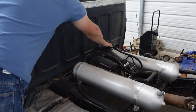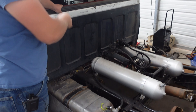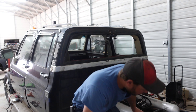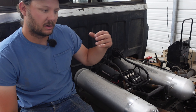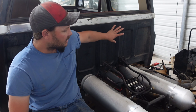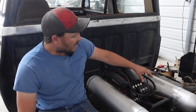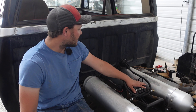Up here we did get most everything from Air Slamit, and from Phoenix because they're in Phoenix, that's why I went with them. We have their five gallon tanks - two five gallon tanks and two of their compressors. I don't remember what these compressors are. And then we have an Evolve manifold. All that's bolted down - none of it's tight, you can move it, but it's there. We're using Level Ride air management system. Right here on the manifold it picks up all our pressures from each bag. Currently these are correct but the controls on my phone aren't correct - the front is the back, and one of the bags when you air it up, it airs down. I don't know if the Evolve chart was bad or the Level Ride wire diagram was bad, but one of them was bad because I wired them up exactly how they were supposed to be and it's not correct.